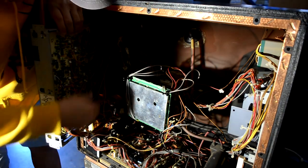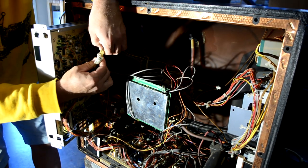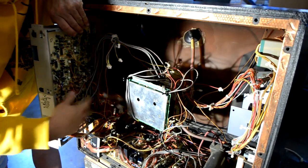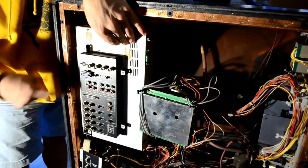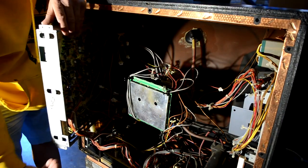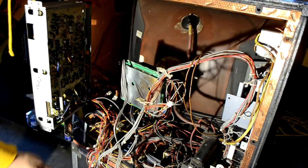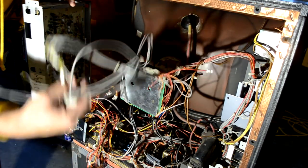I'm going to remove the video board first. It's kind of interesting — everything does have little connectors that thankfully are labeled. So first I need to disconnect all these quick disconnects and make sure that I have my cables loose from my video board. The video board just lifts off of some hinges on here that are very much like door hinges from old furniture. I had to actually disconnect all the cables from the board itself instead of these quick disconnects — those are almost useless.